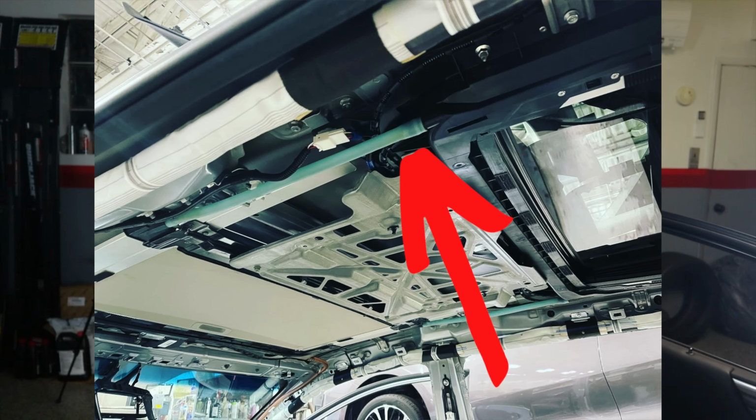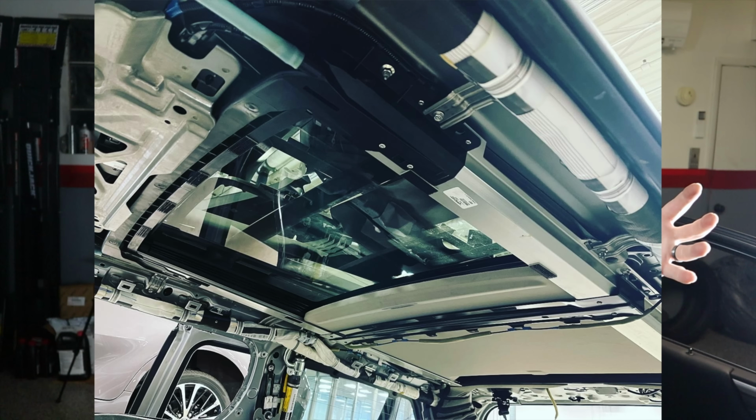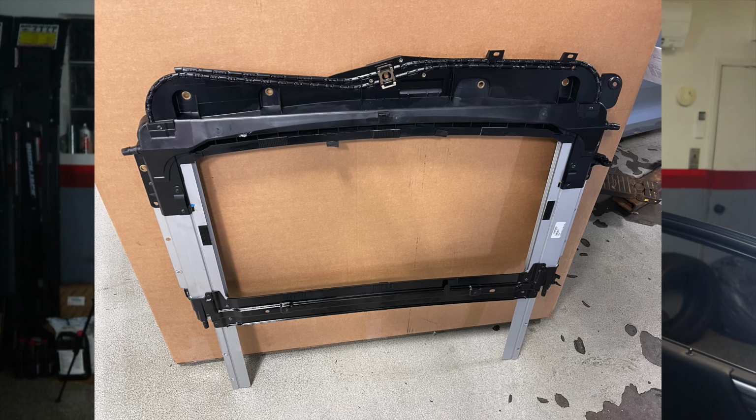Look, folks, I've taken sunroofs apart. All it is is a little clear hose that attaches to a little nipple that comes off the sunroof housing, and it has a little tiny metal clamp, and sometimes some of them don't even have that clamp. So it doesn't take a lot of force to dislodge it. So you can imagine the disaster if the sunroof drain hose detaches from the sunroof housing. It is a disaster. You're going to have basically open rainfall inside the car. Do not use compressed air.